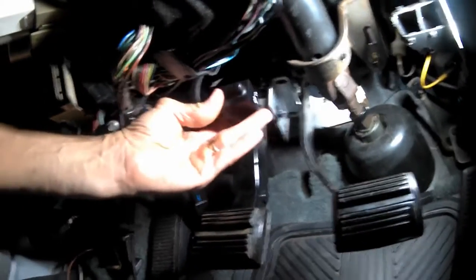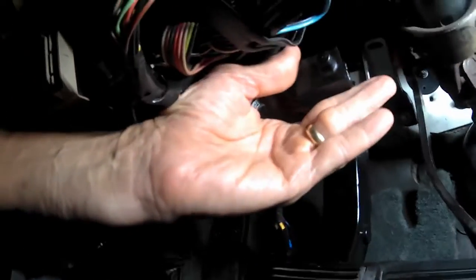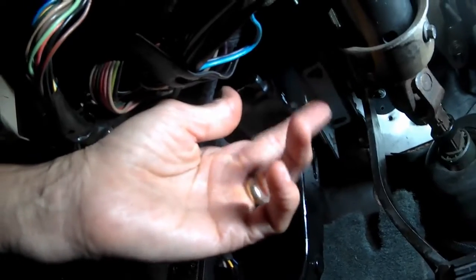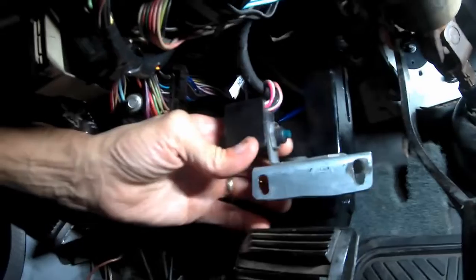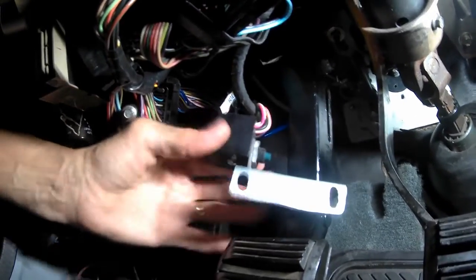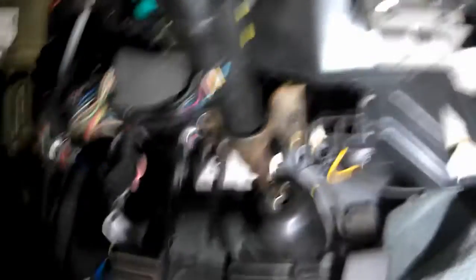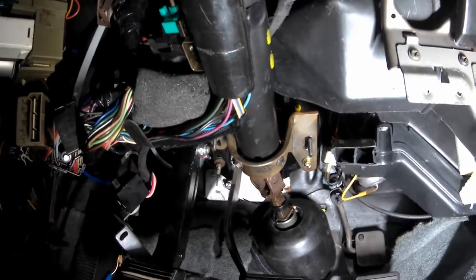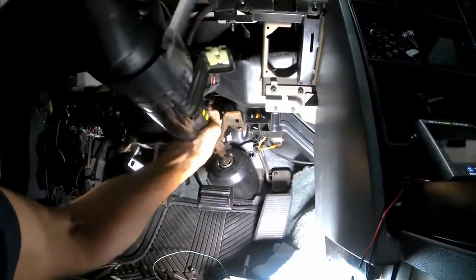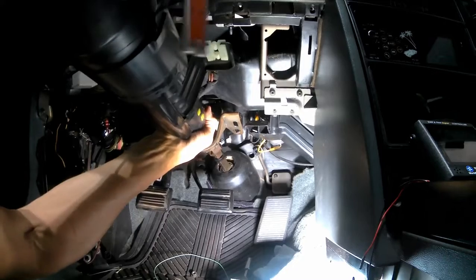I talked about this in video 21 — the clutch switch being used to interrupt the start circuit. I actually adapted it so that it goes in on the studs for the steering. I made these brackets up — that's all it is. When that switch is in, the starter will not engage. I loosen the top nuts at the end of the studs on both of them, so I've got some slop. It actually supports the top of the column. I take the bottom nuts off all the way and then just pop the top two nuts off and the column drops right down. You can see that slides in and out — some WD-40 silicone on there really helps things out a lot.